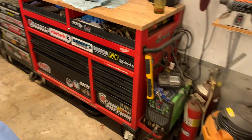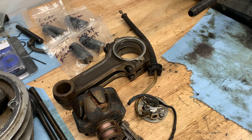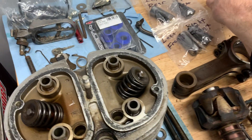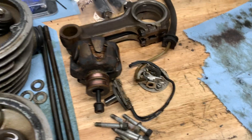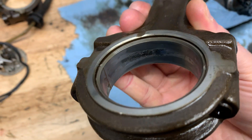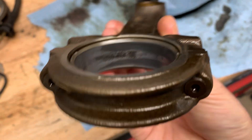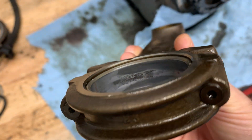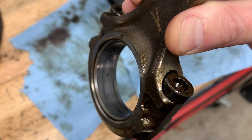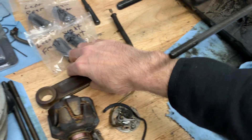The engine I've gotten a little bit more pulled apart. I got my rod bolt tool socket from Napa — it's a special M10, fits in there nicely. Pulling the rods apart, kind of what I expected: the bearings look like they just got a lot of miles on them. There's no evidence of abuse or real damage. From what I can tell there's some wiping happening, no debris or foreign object damage, but probably some dry starts from sitting without much oil. It doesn't look terrible — I could probably put it back in and get many tens of thousands of miles out of it.